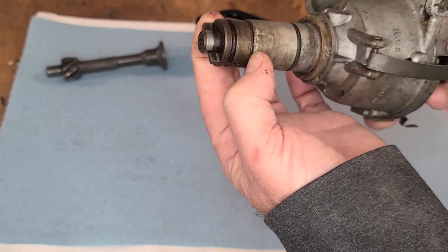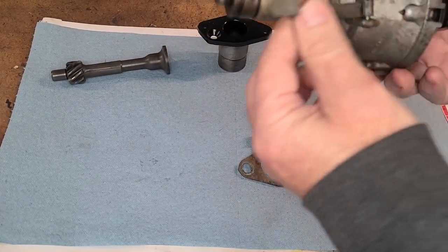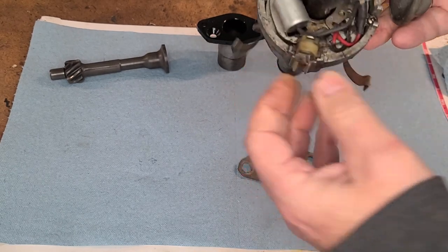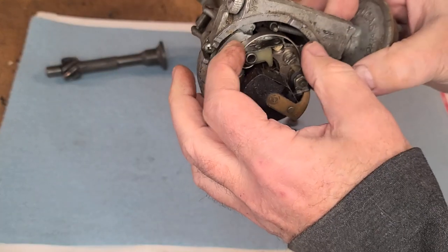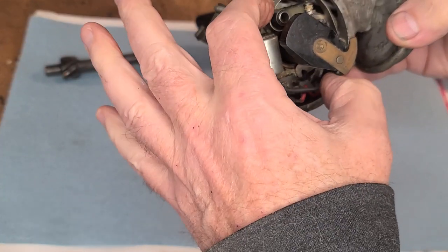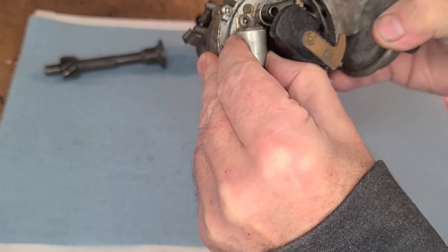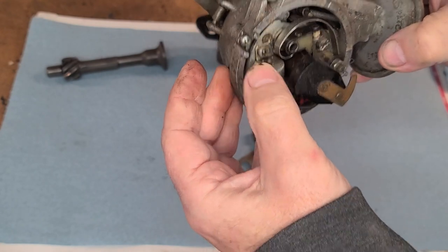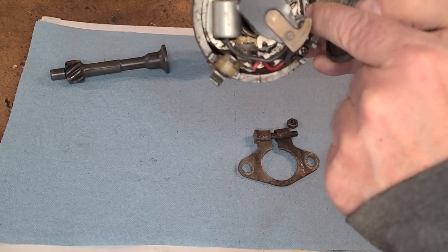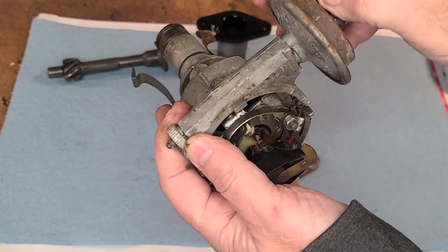It looks like it's a shim and not an O-ring, but we'll get that play out of there and get this thing all cleaned up. There's rust — these little springs need to be cleaned up. The internals are also quite degraded. Normally when you replace these with points — look how crusty those points are — you would replace just this little elbow section, and the condenser would come out as a separate piece as well. We're going to replace all this stuff, take it all out and clean it up, and make sure there's no corrosion or gunk that would impair performance.